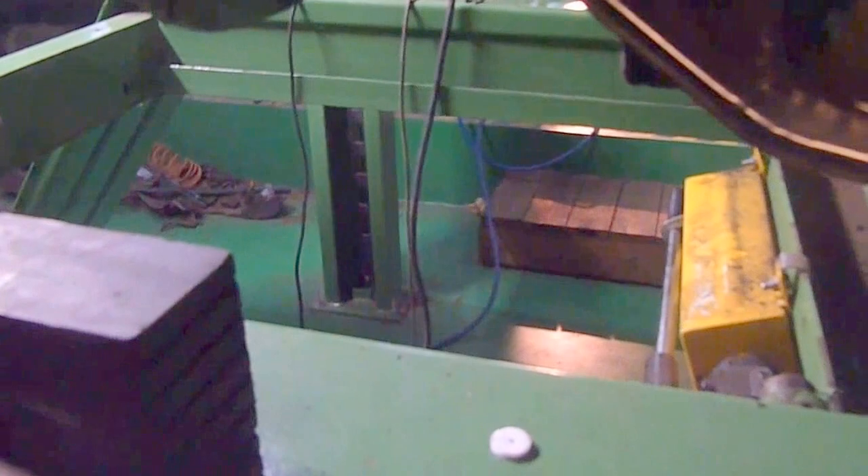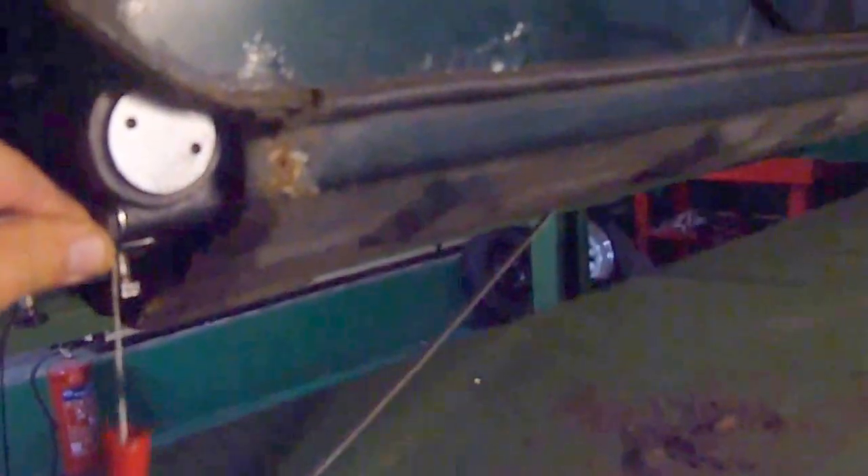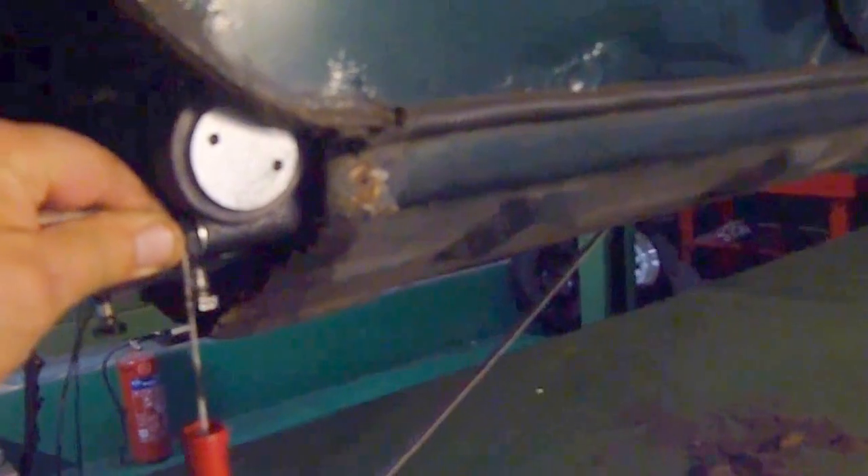The way it's recommended in the British Leyland, Austin, or Rover book is to take a center weight and take a reference point on both sides, then mark them. This is done from the front bolt — this is what's recommended in the book. It might be a bit of overkill, but you can see it's showing that center point. You have to make sure the car is absolutely on flat ground and that it is straight or level to whatever ground you have.